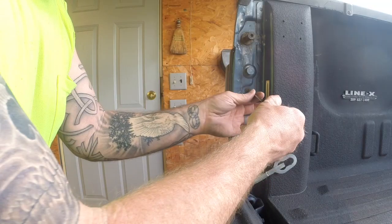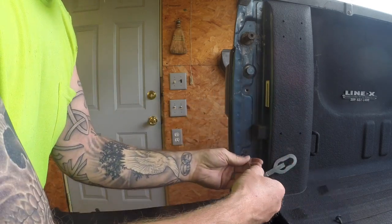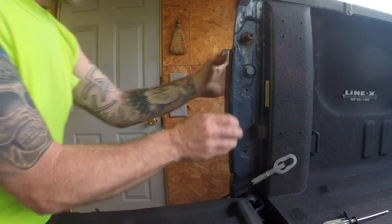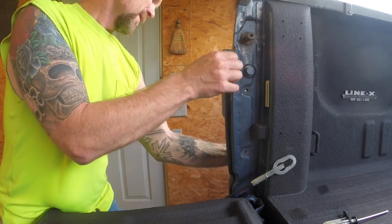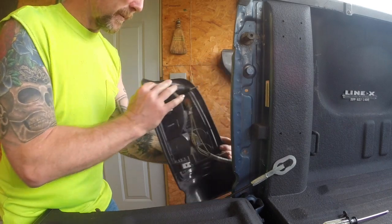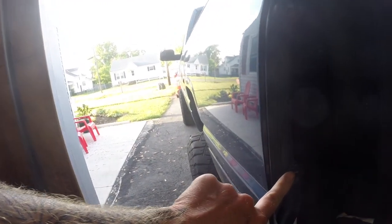on the bottom. So to pull your tail light out, it's T25, I believe, and you just take both of those screws out, and then you got to give it a good amount of force to pull it out, because there's some push tabs on the bed rail side that you hear coming out, which are those right there. You can see them two ribbed pins, and they push back in these holes right here.